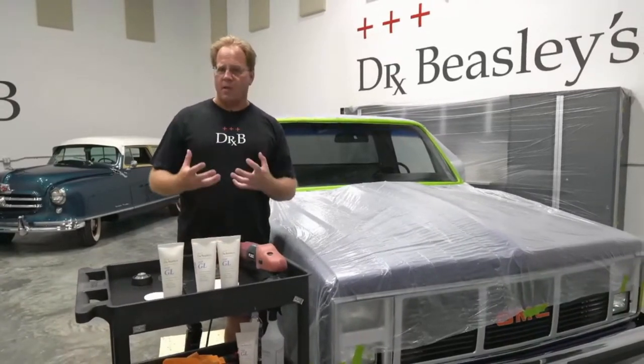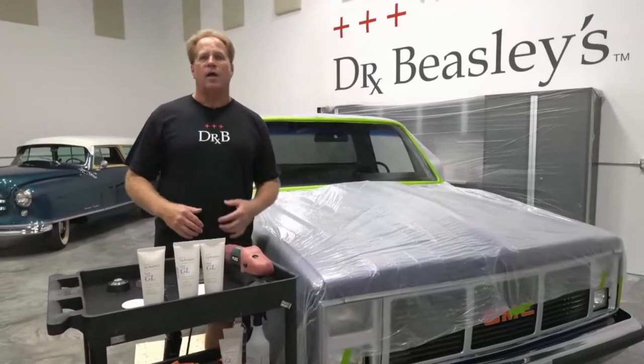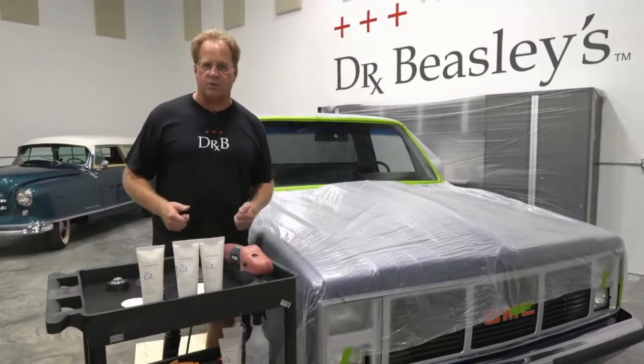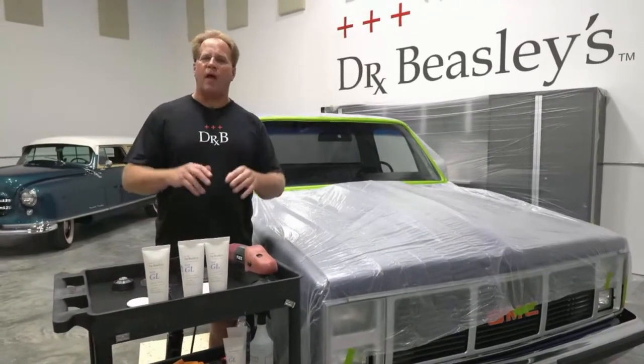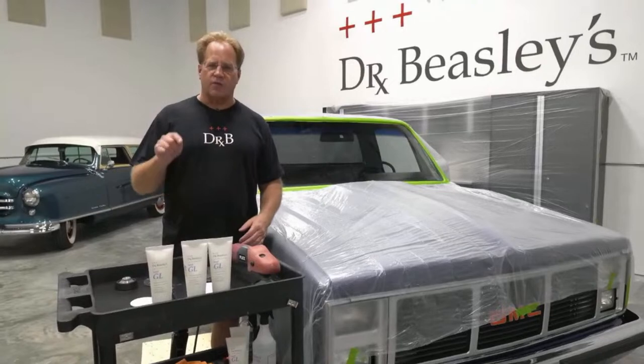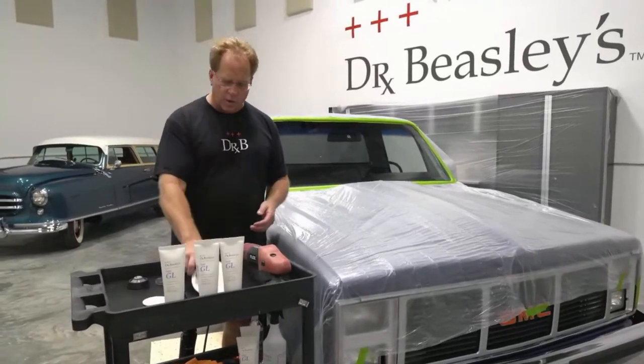I've met a lot of people in my life that said, hey Mike, I read your article, I tried polishing glass, it didn't work. And I would say, what kind of pad did you use? And they'd say, oh, I used a foam pad. I used a microfiber pad. I used a wool pad on a rotary. Those aren't gonna work. You've gotta get the rayon pads. So the polish, the rayon pads, and then there's one more element here that I'll share.